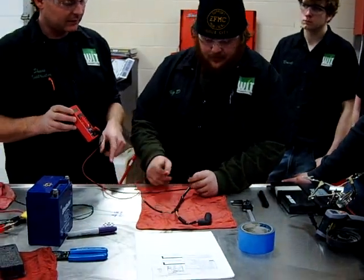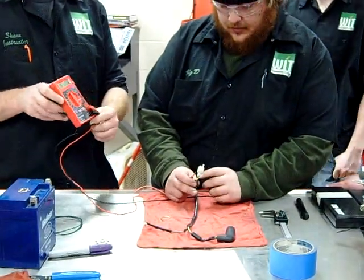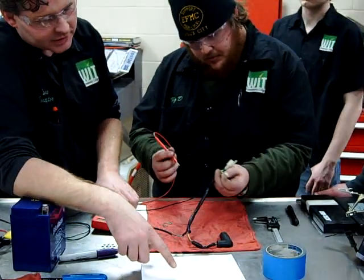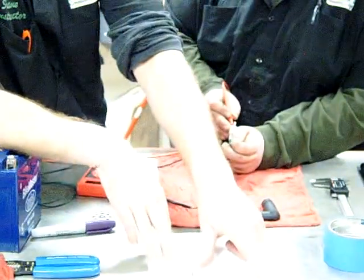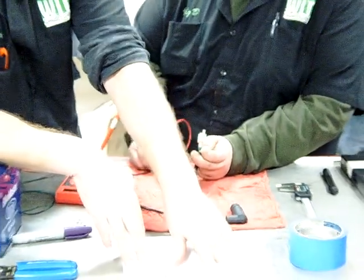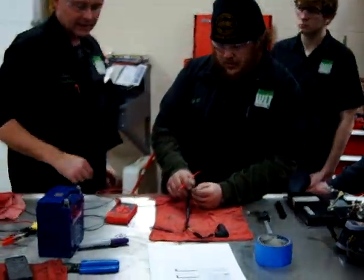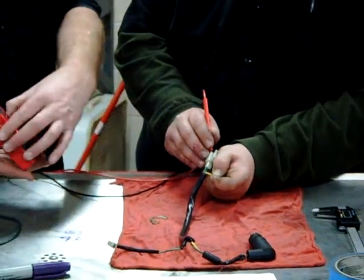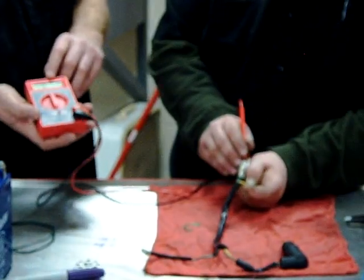He's going to test his meter to itself to make sure it has good continuity. What we found from Honda is 8 to 12 ohms of resistance. Yamaha was also 8 to 12 ohms at room temperature, and Honda said a maximum of 10. So we'll go ahead and test this. Go to the green. We're getting about 7.5, 7.6, 7.4 — something like that. So we have continuity.